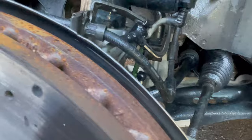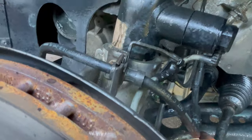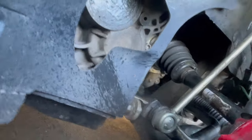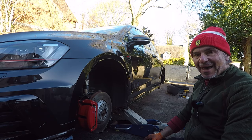This is the level sensor for the xenon headlights — no harm getting wax on there, it's a good lubricant. It's got a bracket on the wishbone that corrodes really quickly. You can obviously brush the wax on if you prefer, but it's going on nicely like this. At the front of the wishbone it gets battered a lot, so that's a lot better. Job done — let's move on to the back now.